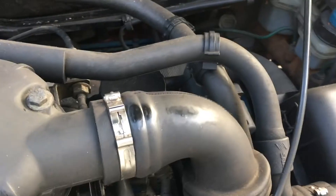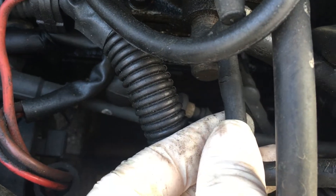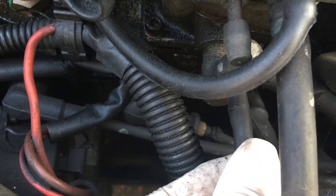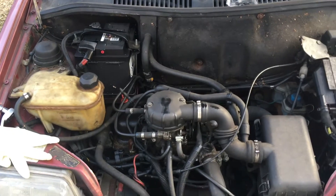I check the wiring — the other end of it, there's the vacuum hose down here. If you can see it, it's a bit perished at that end, and that actually could be the problem — could be getting an intermittent air leak there.